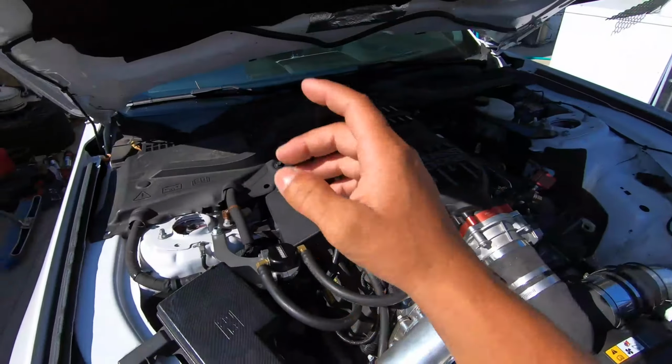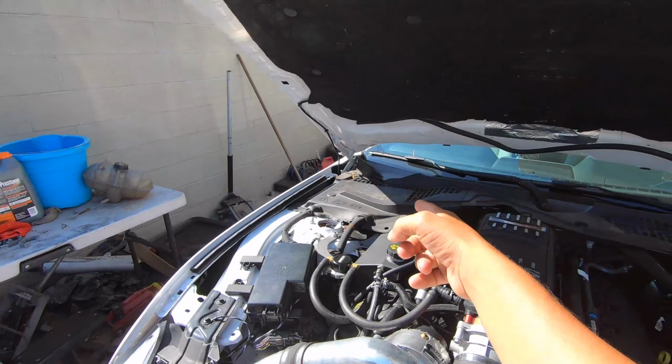Of course, the first thing you gotta do when dealing with the electrical system, always disconnect the battery. That's going to really help you from not getting electrocuted, especially since I've been electrocuted from the 12 volt battery, which isn't that bad, but still you don't really want to do it and fry a system or cause any harm, which will really suck. So of course, disconnect that.